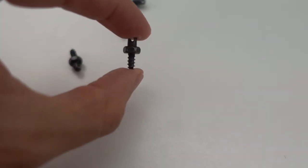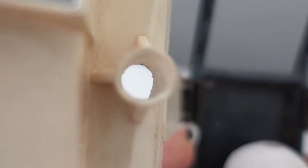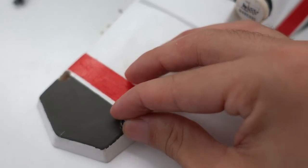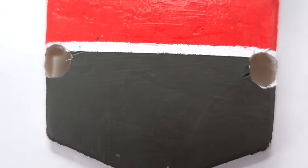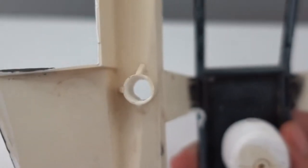These mounts aren't plug and play. You're going to have to dremel out or scrape out a little bit of the plastic inside where the screws were previously housed. You're basically making the opening a little bit wider so the screw post can fit through and you can clip the body clips over the top. Here I'm quickly showing you how much I had to take off from the inside of the original screw housing.